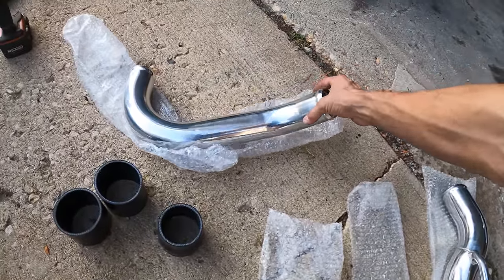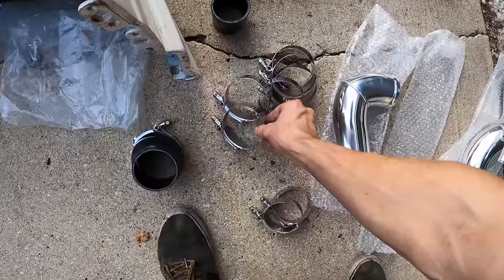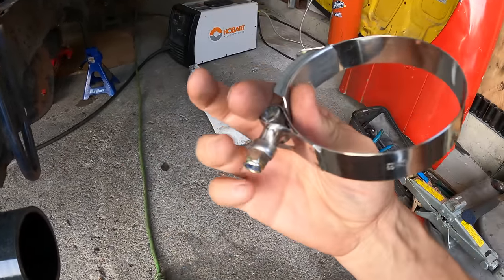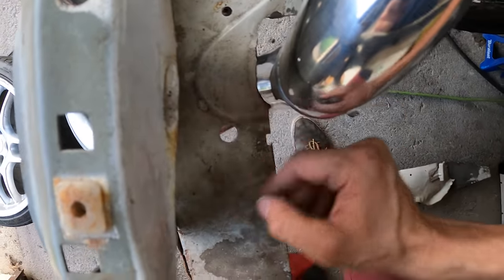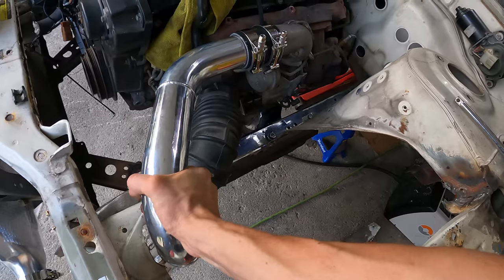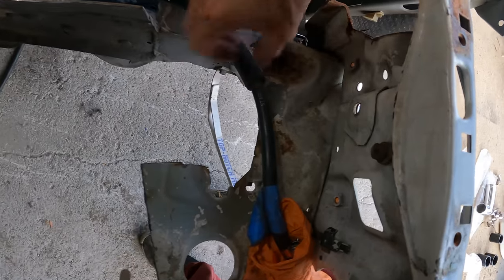So far so good — first pipe is on. I like to put the intercooler clamps facing down, meaning the bolt is facing down, so that way you can still access them if the bumper is on the car. It actually looks like this needs to come up some — oh, we're already hitting. And that just shows the importance of doing this so you know your measurements. I'm going to take this pipe off for now — that's why I didn't tighten anything yet — and I should probably cut the rest of this off as well.